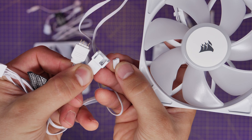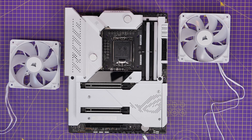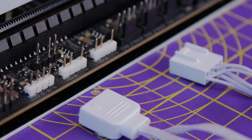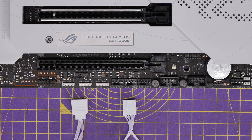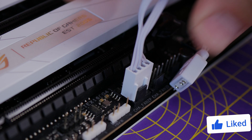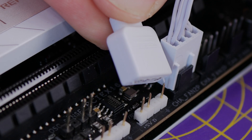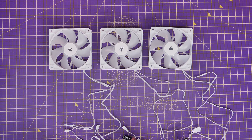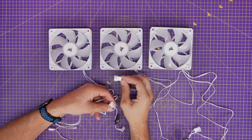You also have extra cables which are essentially daisy chain cables — this one has pins, meaning you can connect multiple fans together. To connect a single fan, you need to connect your 3-pin RGB connection to a 5-volt RGB header on your motherboard — usually marked with 5-volt markings, J-Rainbow, or ARGB. You're also looking for a chassis fan header labelled CHA or a system fan header labelled SYS for fan power. That way you're connecting both the RGB and fan power directly to the motherboard, controllable via BIOS and motherboard software.